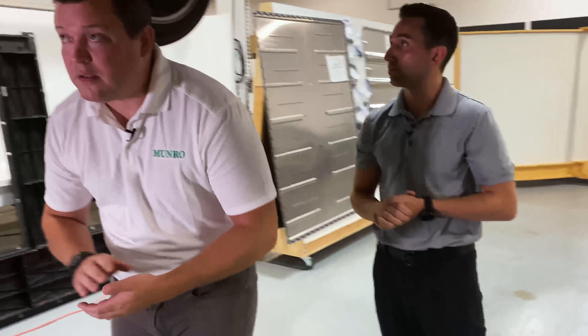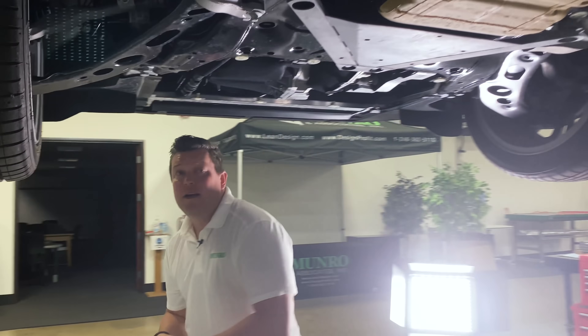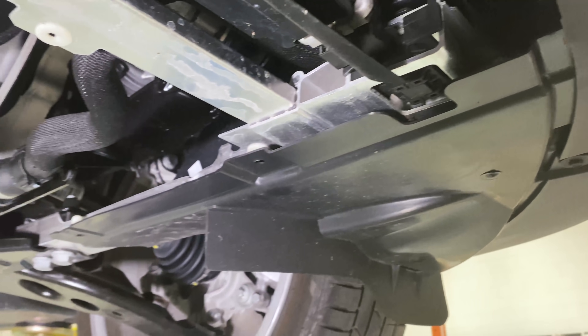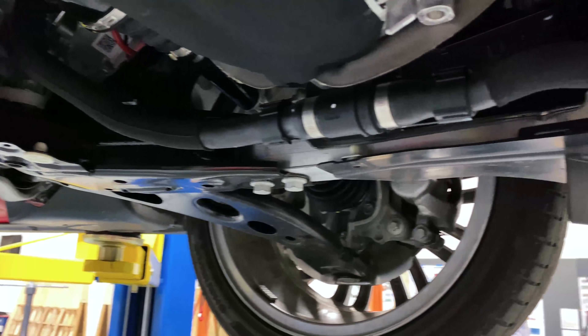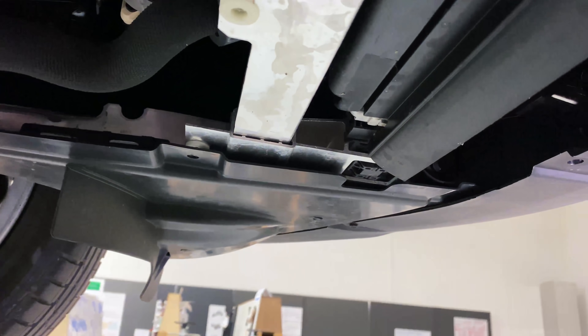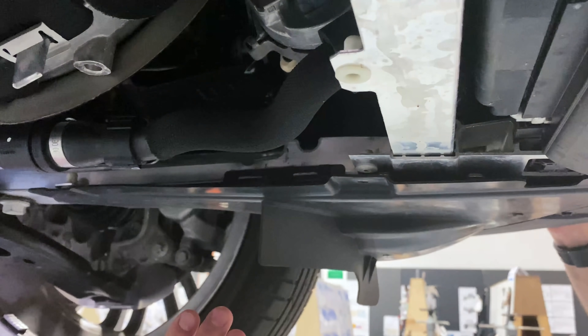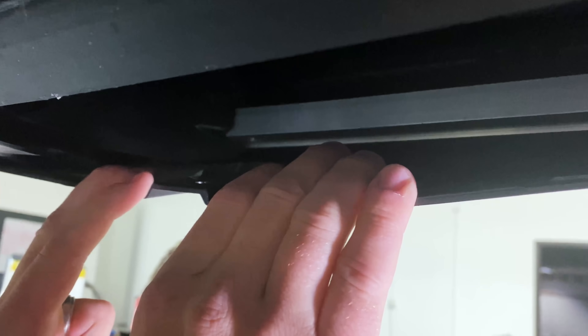The base K-frame is steel, but there are large aluminum extrusions that come forward. They do not come out as wide as we see from other OEMs. Jordan thought most likely it's for PedPro — given that it doesn't go out into that 25% zone, just visually estimating. And if you dip the front of this down, you'll see a quite small aluminum extrusion that bridges between those two points — like the lower PedPro bar you'll see for European applications.